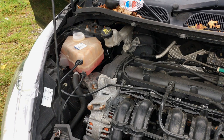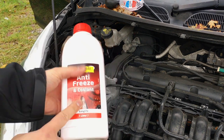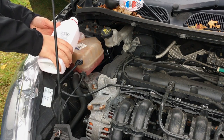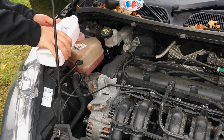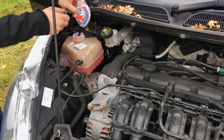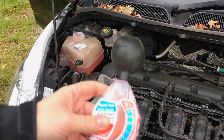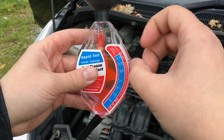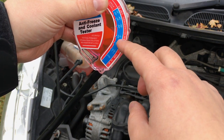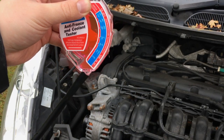For the sake of this car, we can see it's been neglected — the level's below the minimum anyway, so that's bad news. I'm going to get some anti-freeze and stick it in. Make sure you get the right one for your car — just look in the car's manual and it'll tell you which one you need. Let's dip the tester again and see what temperature we get to. Give it a gentle flick again to make sure all the bubbles are removed, and as you can see now, the temperature's hovering around minus 22 degrees Celsius. So it's going to be absolutely fine for UK winters, and the car's not going to freeze.